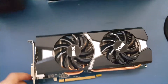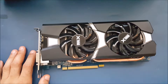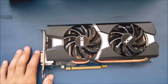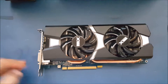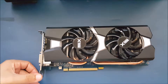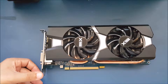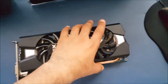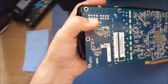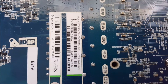Hello, today I'm here for another review. This is my video card, the R9 280 Dual-X. It has 3 gigabytes of VRAM GDDR5, the memory bandwidth is 384-bit, the GPU clock is 940 and the memory clock is 1300. This one was released first, and as you can see it's pretty similar to the R9 280X — it actually looks the same.